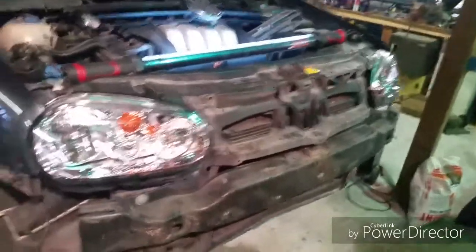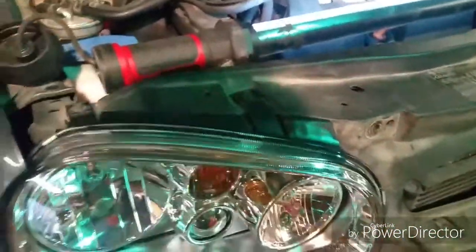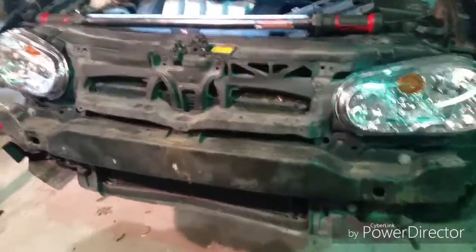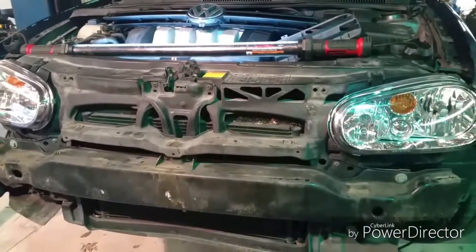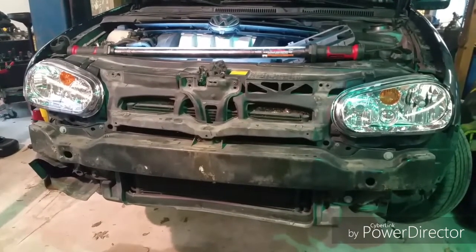I've got some new shinies put on there. They are plugged in. I always just tighten stuff like this with a screwdriver on my T-handles. Here's the reason why: I've got impact drivers and stuff that will tighten that up really fast and really tight. But plastic breaks really easy on stuff like that. It's a harder plastic and it's just not worth breaking the assembly to save 45 or 50 seconds.